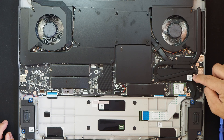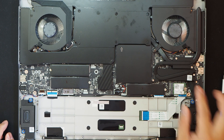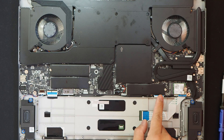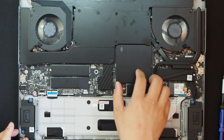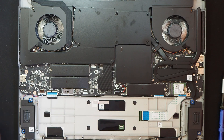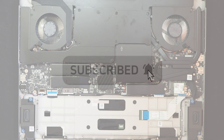There are four screws on the heatsink — take it off and you can replace the SSD with a new one. For the rest of the SSDs, you just need to unscrew one screw each. I think you have to use your hand or a prying tool to take off the metal panel, and then you can add more memory. I heard they have four slots in total. For any questions, leave them in the comment section — I'll do my best to answer. Thank you for watching.